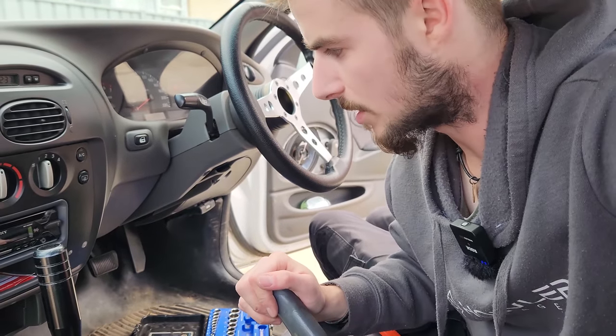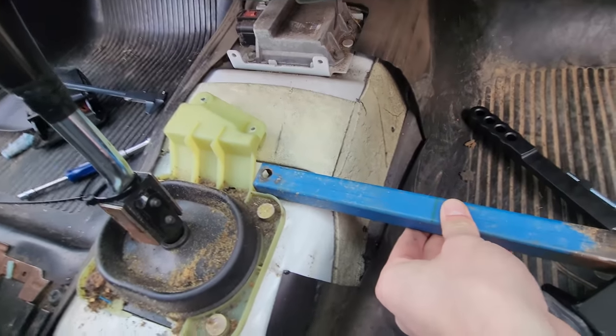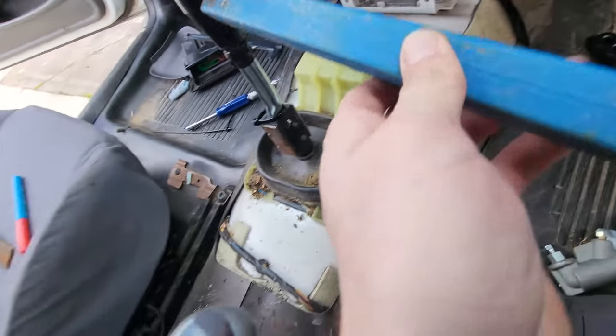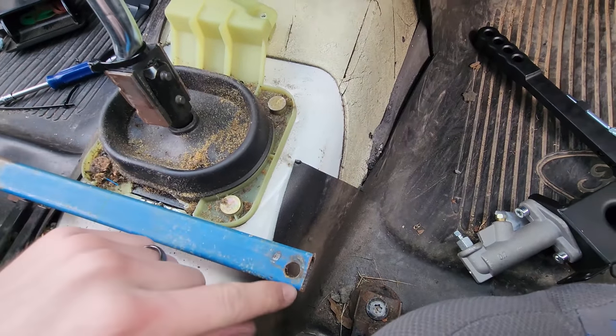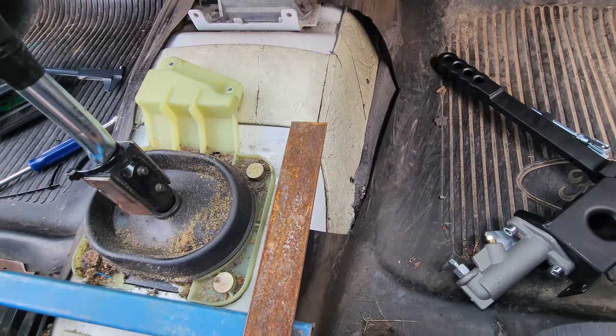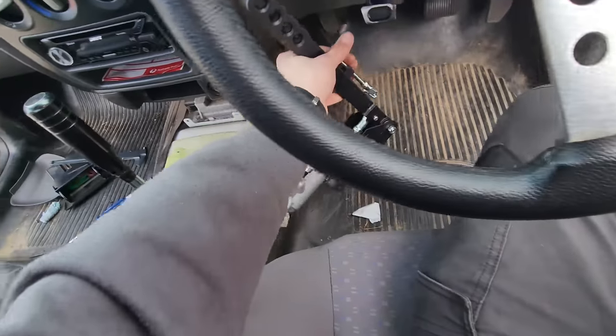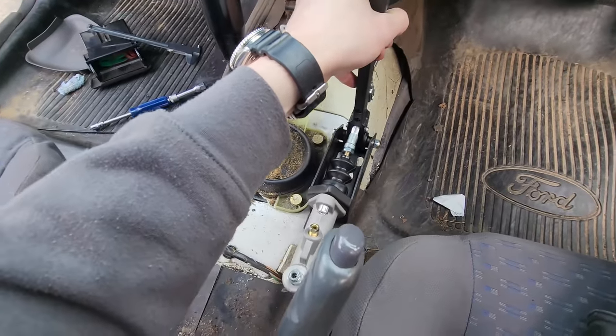Now this is something else - it's optional, but I'm actually going to opt to get rid of this completely because it's going to be in the way and it doesn't work anyway. So I'm just going to unbolt it and cut it out with a grinder and then we'll mock up for the new handbrake. What we've decided is a bit of bar out there, a bit of bar out there, and then a bit of flat bar running that way, and that will place the handbrake basically there.